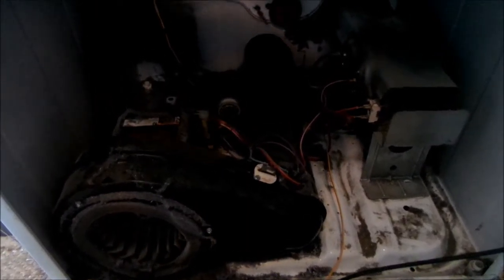You don't have to remove the whole front panel to replace that high limit, but since this thing is full of lint and is a possible fire hazard, I'm going to clean it out, lube the moving parts, and fix the heat. There's the tech sheet.